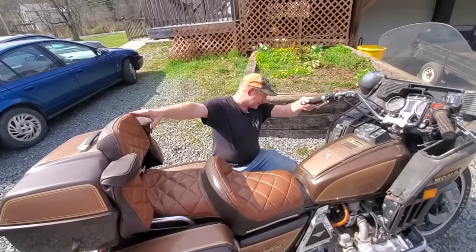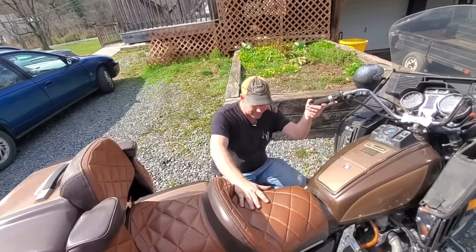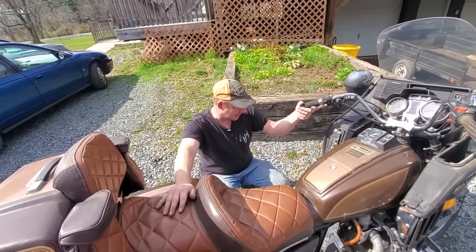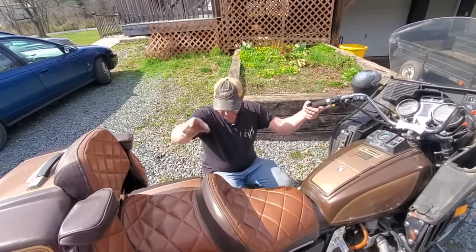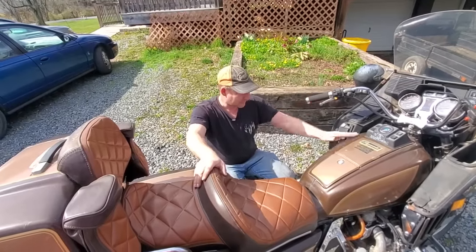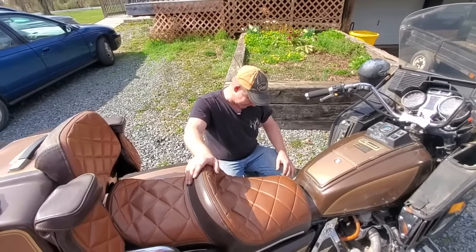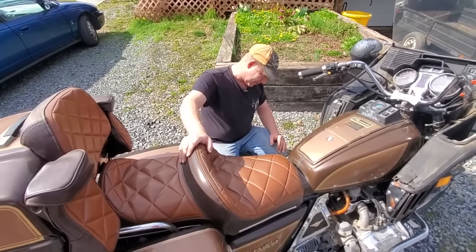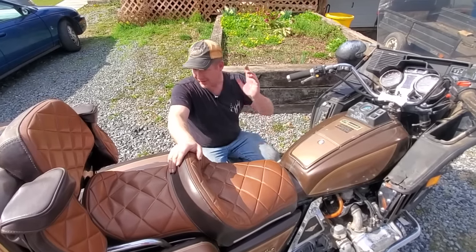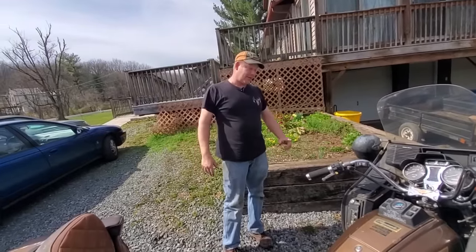And I also want to drain the carburetors, get some fuel out. I'll probably pop the seat back off and pop the sending unit out of the tank, and then have a real good look down inside the bottom and just pump all the fuel out, because there's obviously some water or something in it that it didn't look like it before, but it's definitely water. It's not running healthy at all. So I'll do that. I mean, it rides nice. Doesn't run good.